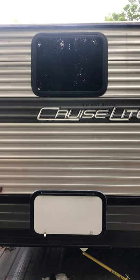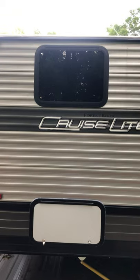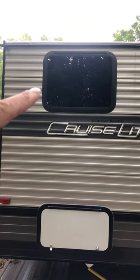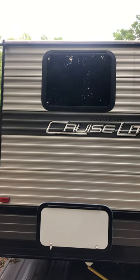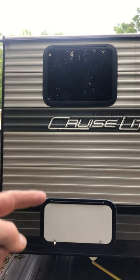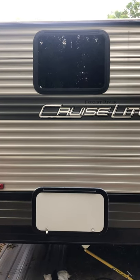Here's how I installed the storage door on a 2020 Forest River. I ordered my door 30 inches wide, which is the same as the bunkhouse window, so that the stud in the wall coming down the side of the window would line up with the stud for the storage door.